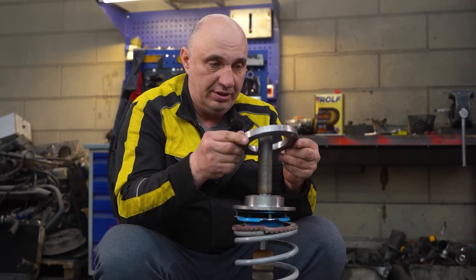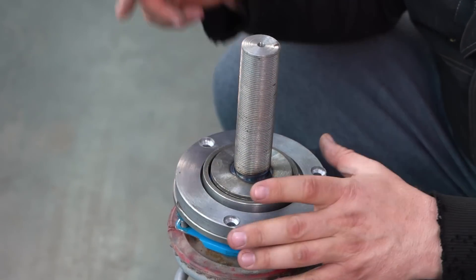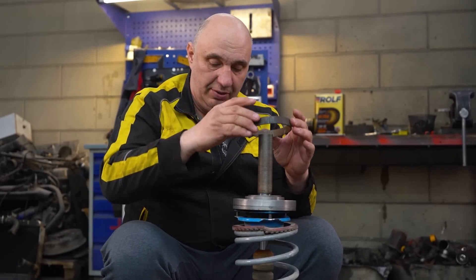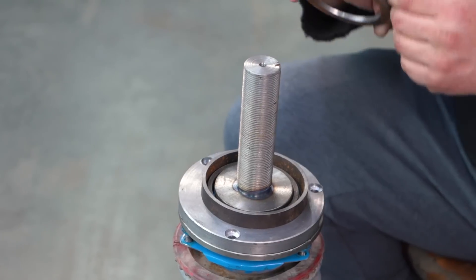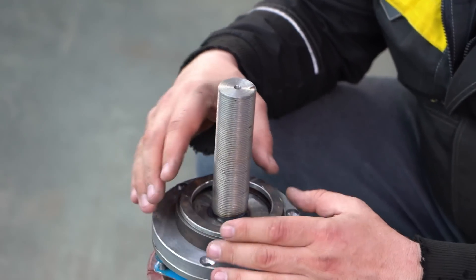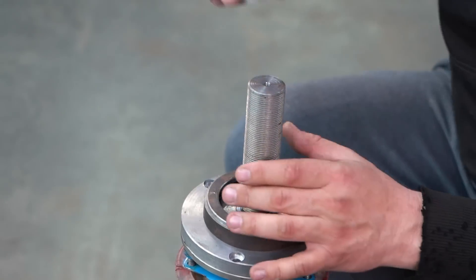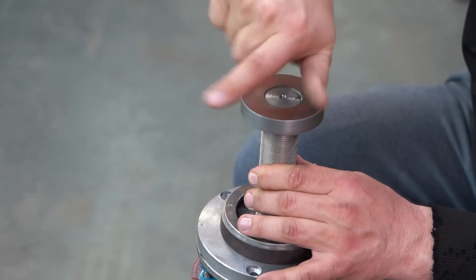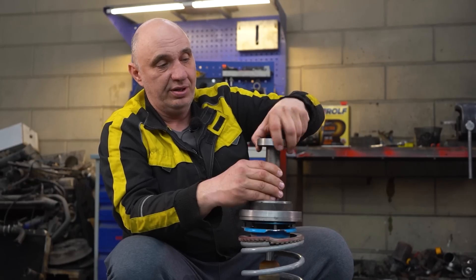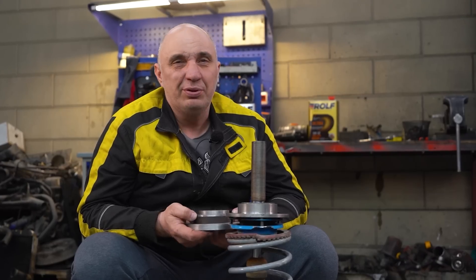For that purpose, we've got this sort of ring that we're going to bolt on top of the strut tower. Over that we're going to be placing a small spacer. The next element is an adapter ring, and to that we're going to be welding a threaded nut. We are putting together a two-piece lift mechanism. Time to piece everything together and see how the mechanism works.